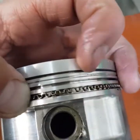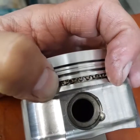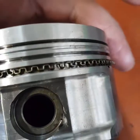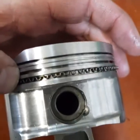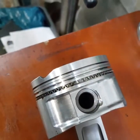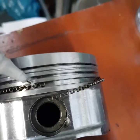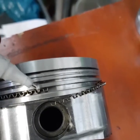If this overlaps, you're obviously going to get a seizure and your oil rings are going to seize up and not work properly. You're not going to get any mileage out of the engine. This ring needs to be sized as well. As soon as I push on it, it needs to sit right inside — you can see that it pops out, so it's too big. Each and every piston that you get, some fit, but every one needs to be double checked. I'm probably going to cut this one off — it needs to be cut off one full tooth for it to be correct.